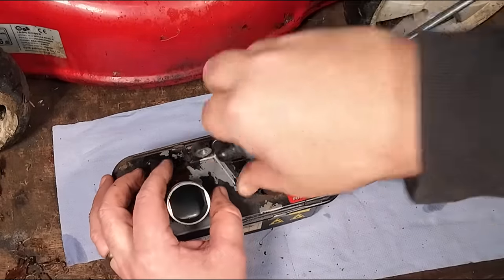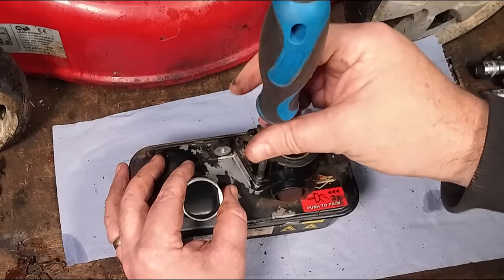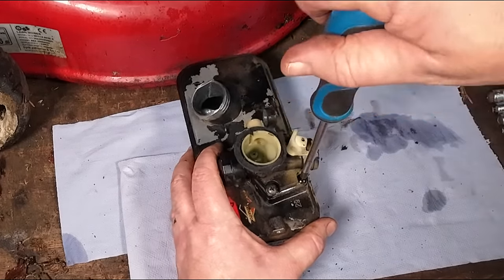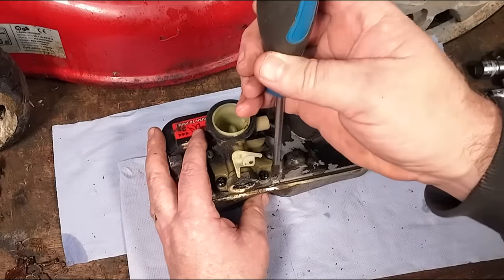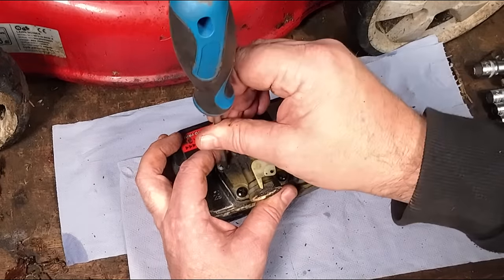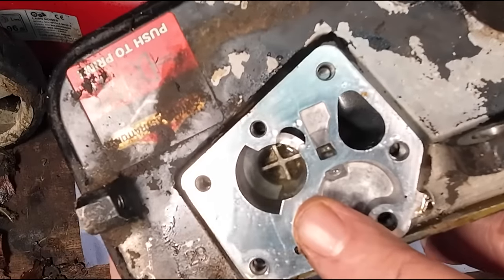Moving on - all the fuel's out of the tank. Now on the carburettor itself there's still one more place to check before we can save it. Remove the five screws on the air intake elbow and take that off. There are about 45 million videos on how to do these on YouTube, but for an old engine these are still very common, very easy to fix, and the parts are still really readily available. Remove the five screws and you can then remove the carburettor from the tank.